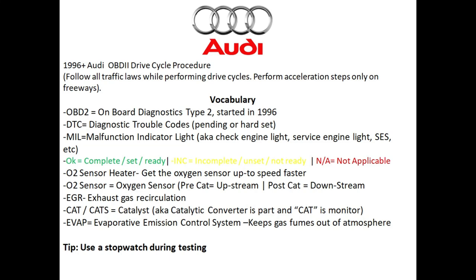If you're in a situation where your check engine light is turning on within milliseconds, you probably have some kind of hard set code caused by an open circuit — so it could be damaged wiring or a damaged sensor. Something is basically causing that short to get identified instantly because most of the time the vehicle is going to run a check and it shouldn't happen that fast. Go figure out what's going on before you attempt the drive cycle, because no matter how well you do it, if you have a pending or hard set code in the system, it's not going to work.